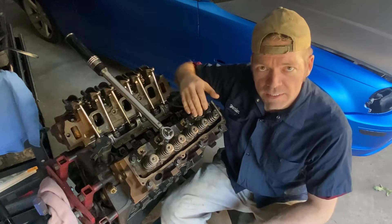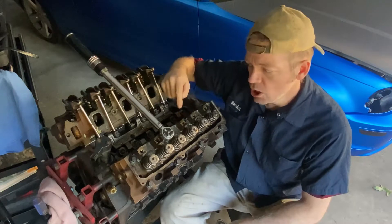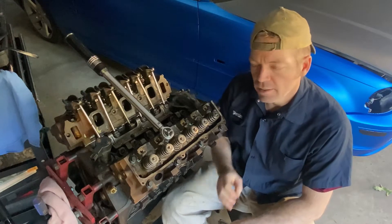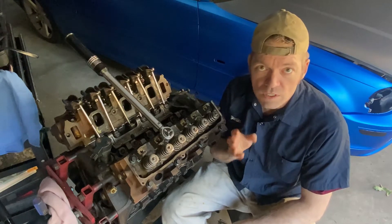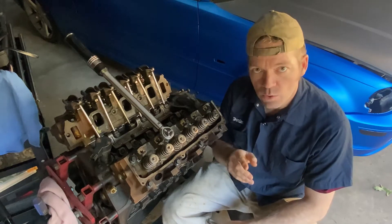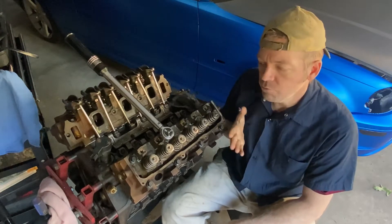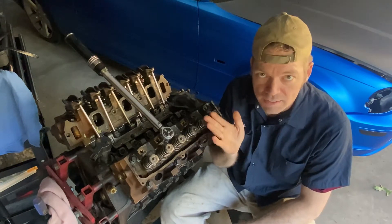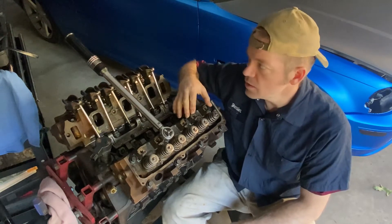Now, if you've ever heard of a bad head gasket, or you're blowing some kind of smoke and you don't have very much power — right here, the gasket underneath where we put the head on top, that's what you're going to have to change. Now, there's a very special technique in doing your head gasket. It's not like other bolts. When you use these bolts, they're supposed to be a one-time use, and in this process you actually tighten them three times. So that's why they say it's only a one-time use. If we made a mistake and we have to take the head off, then the bolts are kaput, and we have to buy some more.